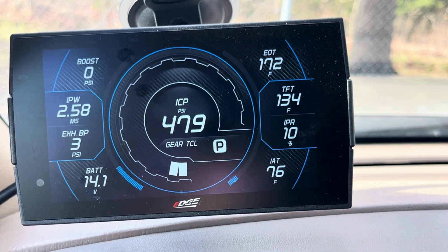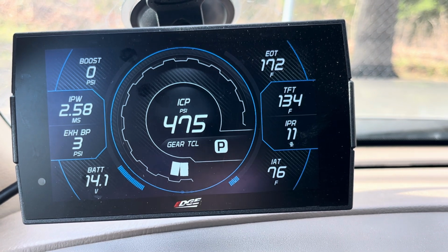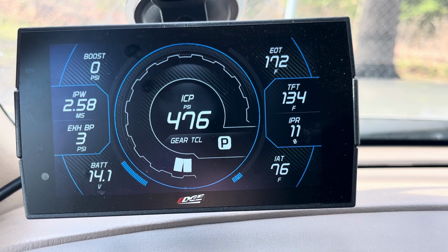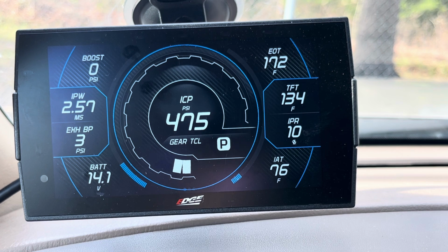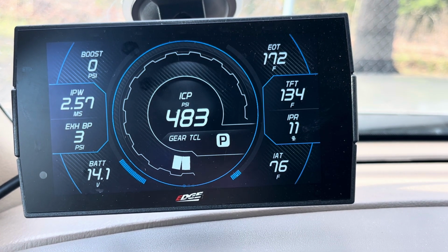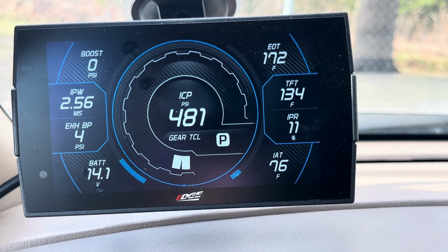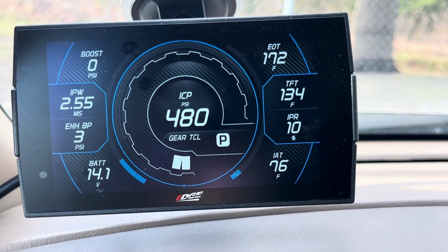You're probably trying to keep the truck under a certain point, and that might be 210, 220 degrees, whatever your preference might be. Realistically, by about 230 degrees would be the highest I would want to run my oil up to. Now, it might depend if I was towing up a big hill, I might push it slightly further, but definitely by about 240, I'm going to want to be letting that cool back down.